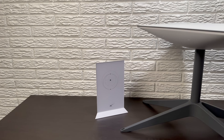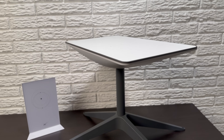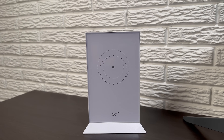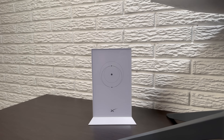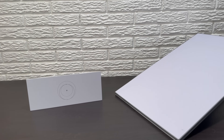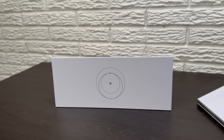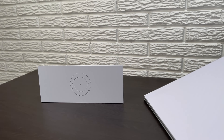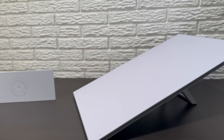So what is bypass mode and why would you even want to turn it on? Bypass mode allows a third-party router to take over all the network management duties on your system. It turns off the Wi-Fi from the Starlink router and disables all the routing functions like DHCP, handing out IP addresses, etc. It basically just turns the Starlink router into a power supply for the dish. With how Starlink is designed, you can't just take the Starlink router out of the system because it powers the dish, but bypass mode gives you a way to use your own router without running into some of the network issues that can be caused by having two routers on the same network.